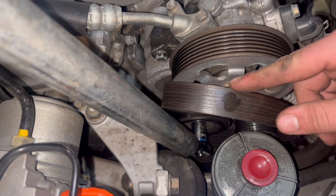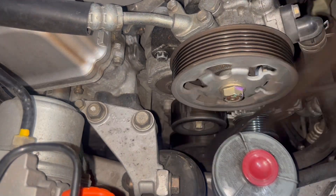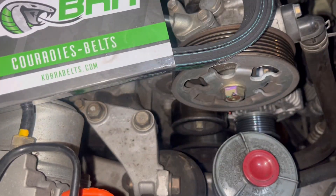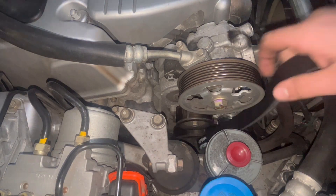The pulleys are loose — just pull off the bolt, look at that. Just drop it back, then you can remove your breaker bar and the whole belt will drop down. Boom — out with the old and in with the new.